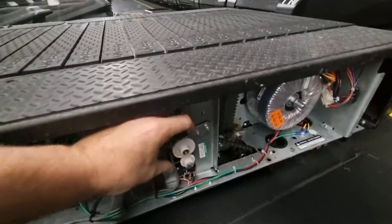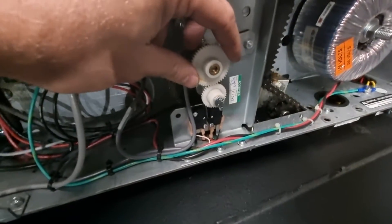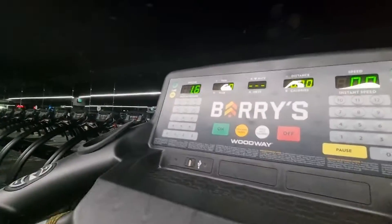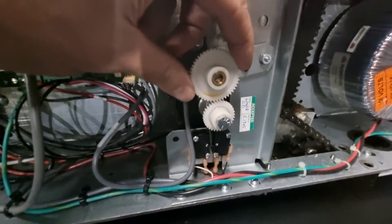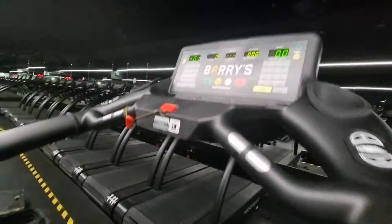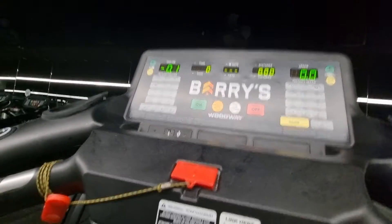So what you've got to do is lift it up and turn it back the other way — but without turning the bottom one, you just want to turn the top one, that's why I've loosened off those two nuts. It's gone back down to 1.6. If I lift it up again, turn it again, and put it down — sometimes you'll hear the incline motor actually go. This treadmill is still powered up but that's fine, we're only playing with this cog here. Now up here you can see it's at minus 0.1.